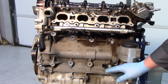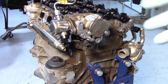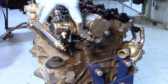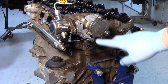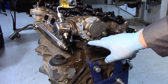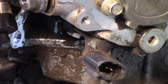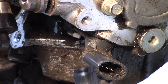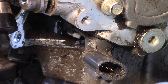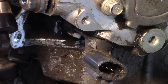There is one crankshaft sensor but two separate cam sensors. On the back side of the engine you can see the back of the intake cam, and there's also the high pressure pump for the GDI fuel system. The cam sensor on the intake side is located off the back here. Zooming in you can see the intake cam sensor — it uses just one bolt and is relatively accessible.